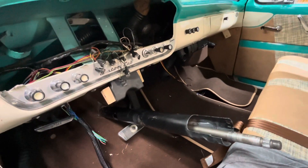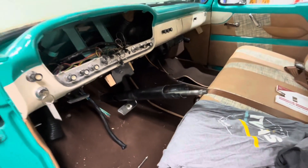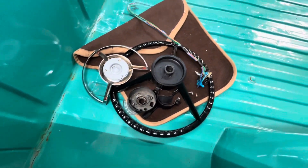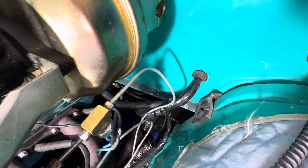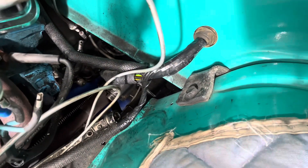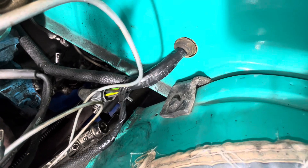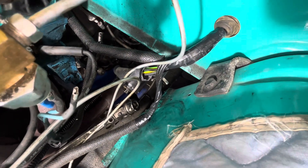The column definitely has to come out from the engine side. I've taken everything off so the tube will slide down. Here's what it looks like out here on the firewall. That shift lever — it won't allow the column to come out from the interior, so we're hoping we can hold the linkage out of the way and it'll slide out to the bottom of the frame.